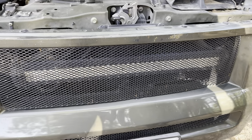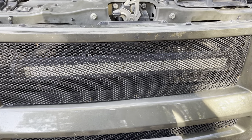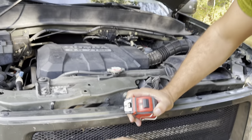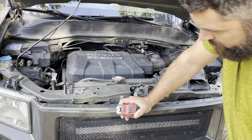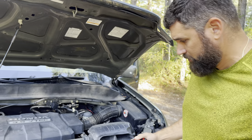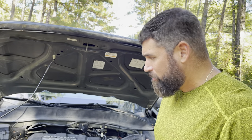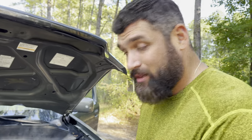It's about a 30-inch light bar. You can't go much bigger than that, and I wouldn't go smaller either, because if you do you're not going to catch those angled metal members to attach the light bar to and have something rigid for it to hold on to. But that's it — nothing special, super easy. Hopefully that gives you guys some ideas and really helps you out.